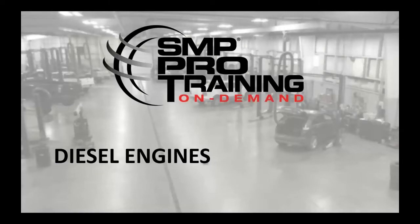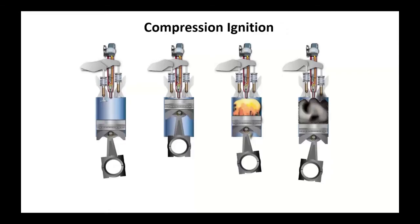Now, let's start off with a basic diesel engine. This is a little bit of review. Understand, a diesel engine is a compression ignition engine. Okay, we've still got the four strokes: intake, compression, power or expansion, and exhaust. The big thing is there is no spark plug. Okay, we're going to bring in massive quantities of air. We're then going to compress that air. That's all we're going to compress.